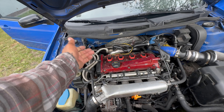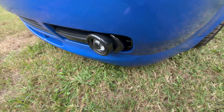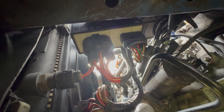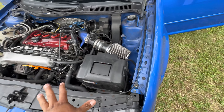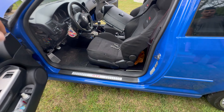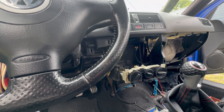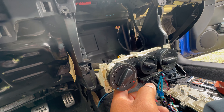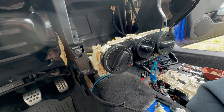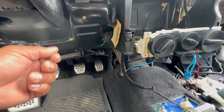I plugged the gauges on this car and kept testing different relays - I tried three or four different ones to see if I could get it back to work. Nothing. I kept checking the fuses and everything and it still wouldn't turn the AC on. Everything was sending a signal back to the relay. I could test the signal - it was working from here to the relay, but nothing was coming out from the relay to the AC.